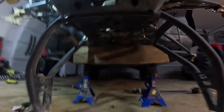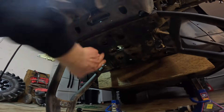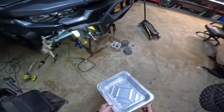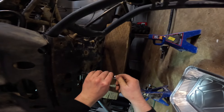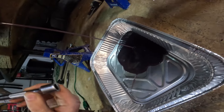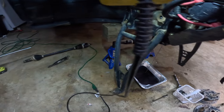Sorry if that was really hard for you guys to see. There are four 15 millimeter bolts that look just like this, and those come out. Now this whole diff should be mobile in there — she's moving. Before we get it out, one thing we almost forgot to do: let's drain this fluid real quick — you don't need any more headaches trying to take this thing out. That looks good — minty fresh. Take your drain plug out, when it's done put it back in that way we don't dump it all over the place while we're finagling it.